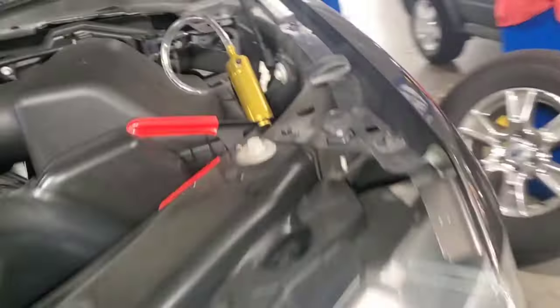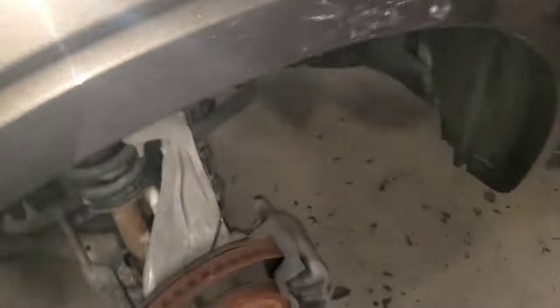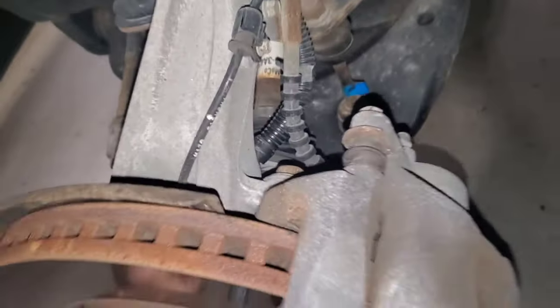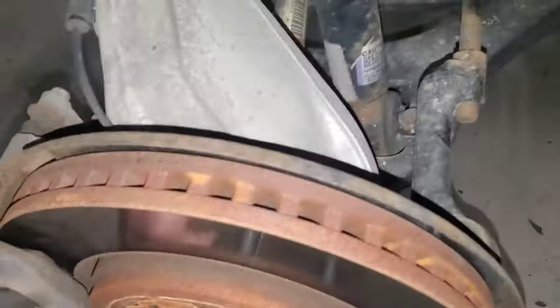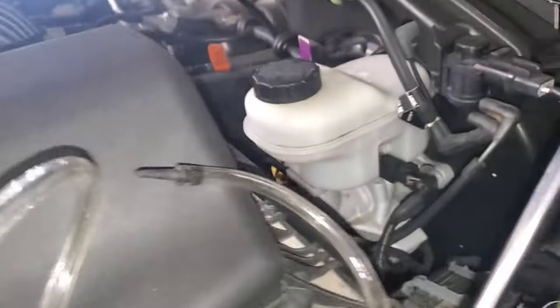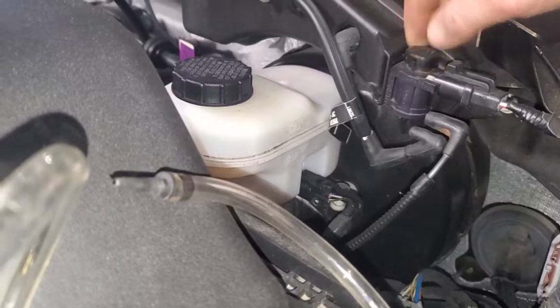Now I'm going to bleed my pressure off and make sure they engage with no vacuum on it. Everything's bled off and the CV axles are beginning to engage with the rotor — you can see it's fighting me, they're not turning freely anymore because the axles are now engaged. I go over to the other side and make sure this one does the same thing, and it is engaged — the axle is actually turning with the hub assembly and the rotor.